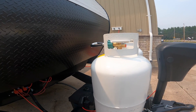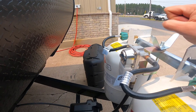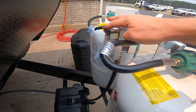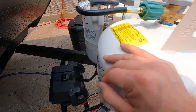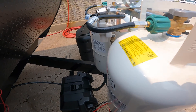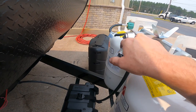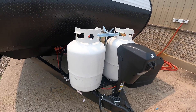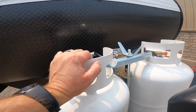This is a double-bottle 30-pound system with a crossover regulator to connect the two bottles. The handle pointing toward one bottle means the system draws from that tank first. However, once pressure drops below a predetermined amount, it will automatically cross over and draw from the other bottle regardless of where the handle is pointing. That way, on cold nights running your furnace, if you run out of propane, the system switches over automatically — you don't have to come out and manually switch bottles.